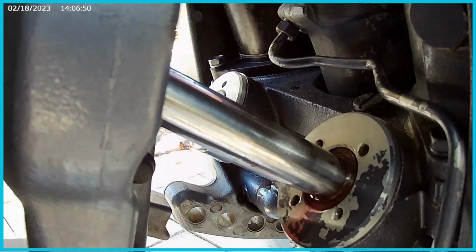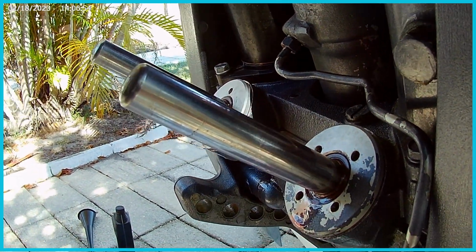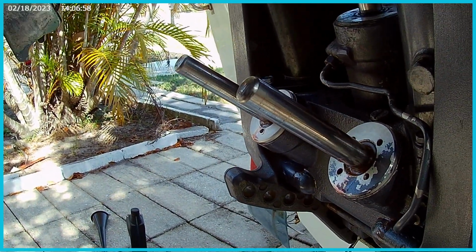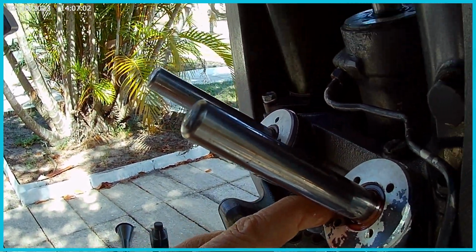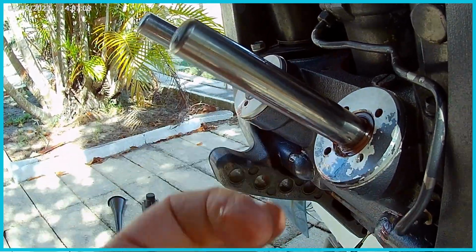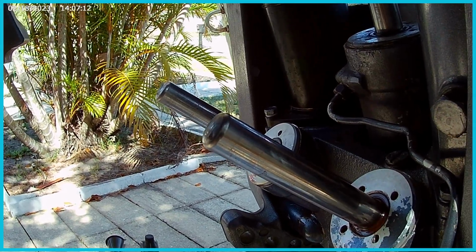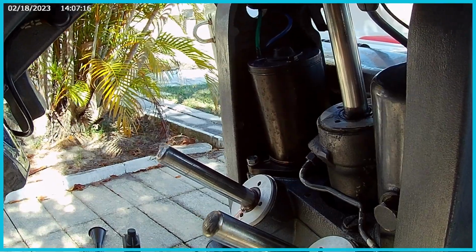And I actually had to pump most of the fluid out of there at one point when I was out on the water. When I came in, I couldn't trim the engine, so that made it really tricky towing the boat home. So that's what we're going to fix today. Going to remove these caps right here, put new caps on, and then inside on these pistons, these rams, I'm going to put a new piston seal in there, and then we'll just reinstall it, and hopefully that fixes it. If not, well, we'll burn that bridge when we get there.